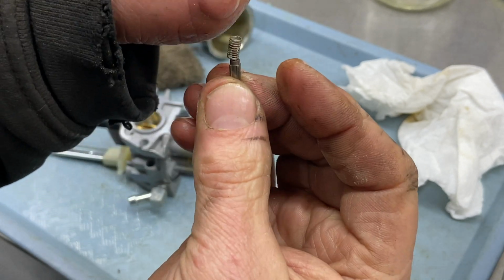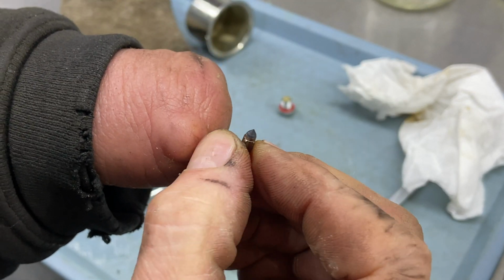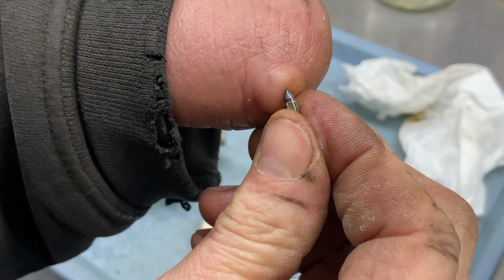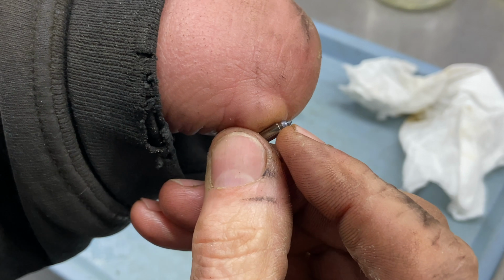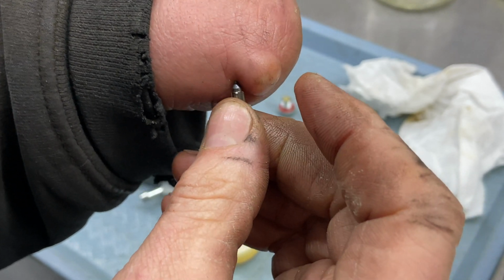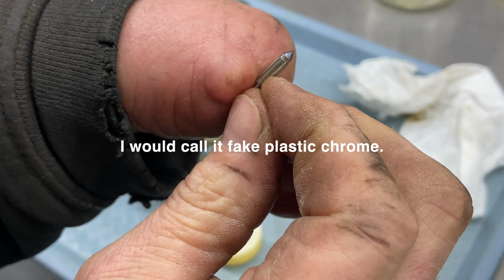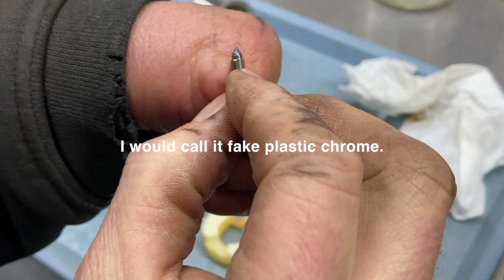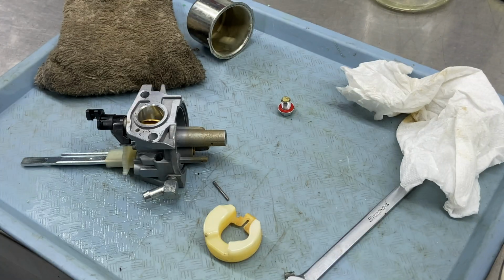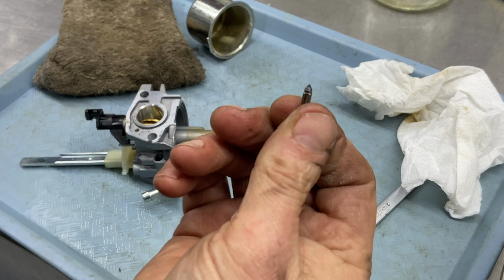It goes right over the top of the needle valve, and it's spring loaded. This is the important part. This is like the neoprene. I usually put this underneath a magnifying glass because my eyes aren't that great, and I'll see how bad it is. If there's a real bad indentation ring on here, then you're not going to use it. And I don't know if you can get the parts for these. You might just have to replace the carburetor. Also, for some reason, the chrome will delaminate, like it'll come off this and start peeling. If that happens, you don't use it. I'll look underneath the magnifying glass real quick. I'll be right back. Yeah, this looks to be in pretty decent shape. I'm going to go ahead and throw this in the ultrasonic cleaner, but you can just clean this up.